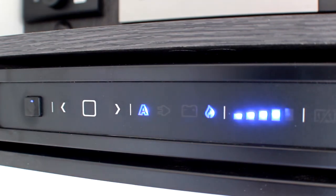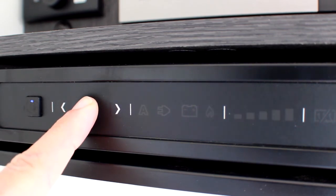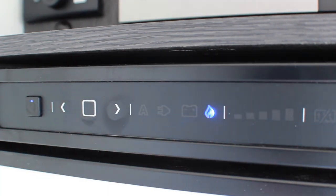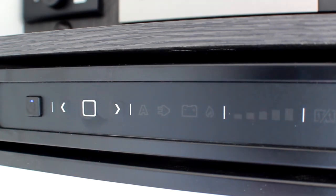Flashing lights and beeping means there is no power source available. To select the power source, press and hold the black button between the two arrows until the power source symbols flash. Use the arrow buttons to scroll to the power source required. Press the black button again to confirm. The fridge will then power up automatically.